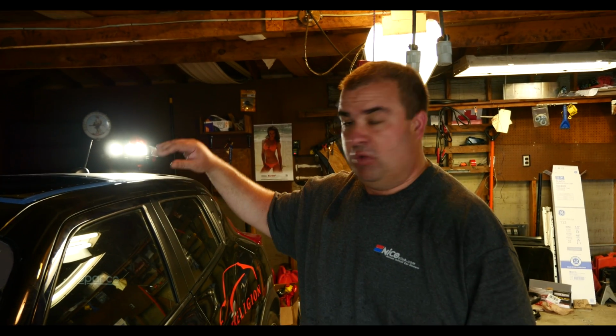The last thing is, before I rivet it down, I'm going to put a bead of sealant around, to make sure that it's nice and watertight. And also the rivets I'm using are closed-in rivets which don't allow water to go through, so that'll help prevent water dripping in under heavy rain.